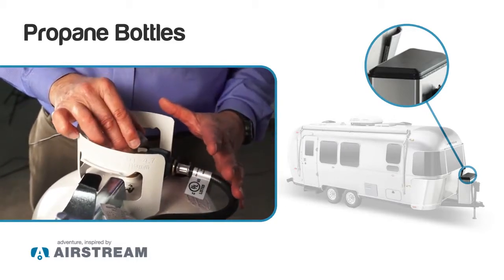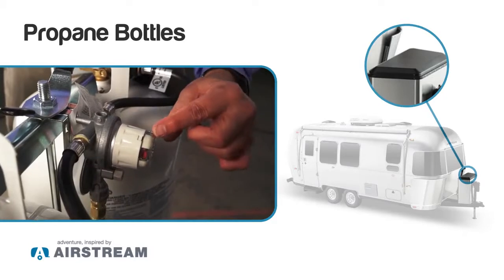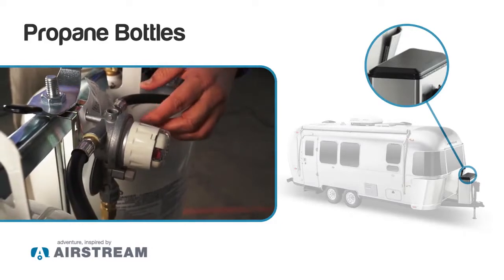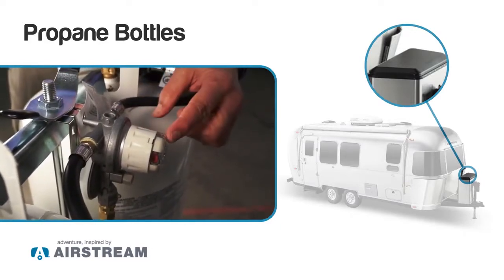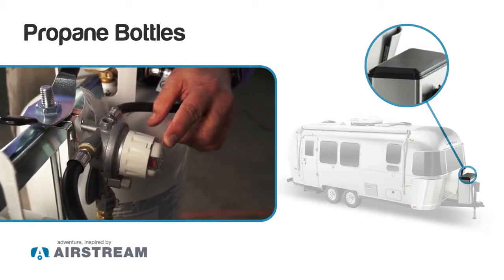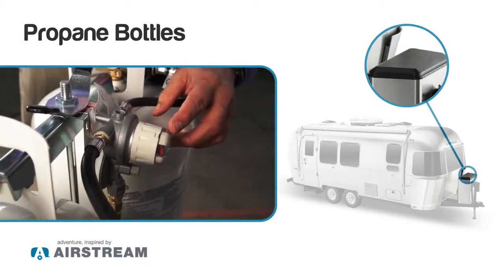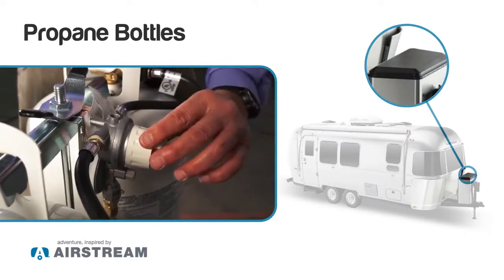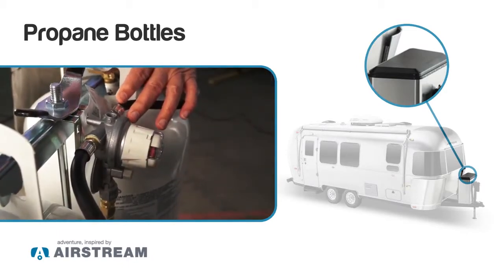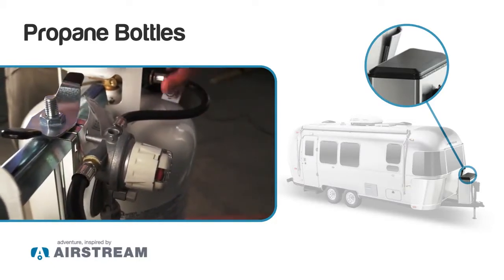So you want to turn that on, and when you turn that on, this little regulator valve here has a red and green indicator. If it's got propane in, this red area here will turn green, signaling that you have propane. This will stay green until this bottle has been depleted. And this is an auto switchover regulator, so once this bottle is empty, this will automatically switch to the reserve bottle. And then later, once you realize that that is switched, you're going to want to take this arrow and turn it towards the bottle that you're using now, and that will become your main bottle, and this bottle will be taken off and filled and put back on.